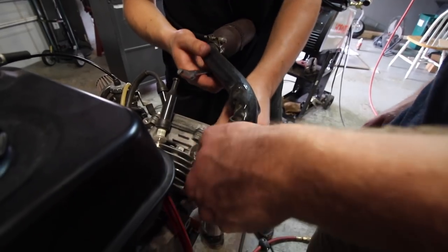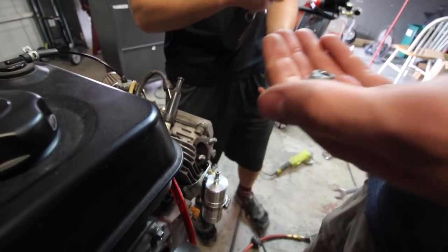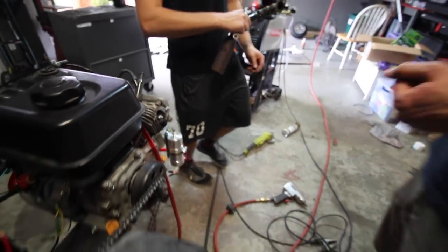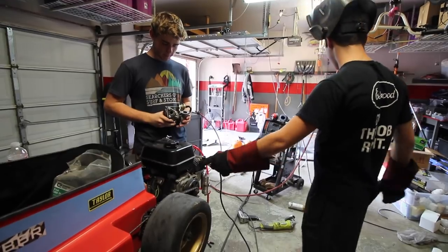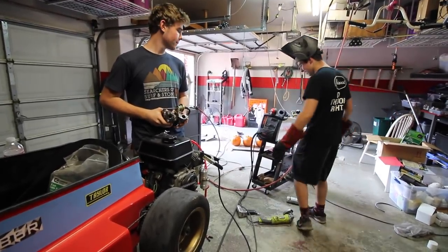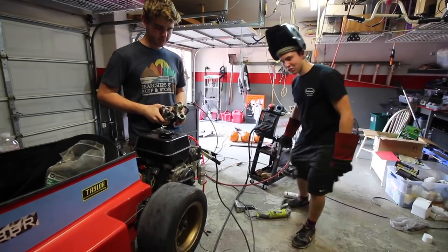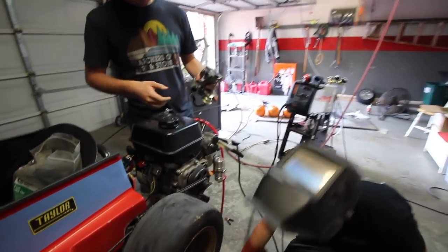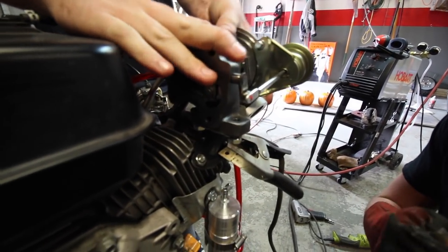12 millimeter, half inch, basically the same thing. Yes, sir. So now, oh, that would have been bad if it went in the engine. Okay, turbo time. Manifold, and we have this stock exhaust header that we just kind of cut, and now we are finally mating the turbo to the engine with welding. Yeah, try to get her as straight as possible.